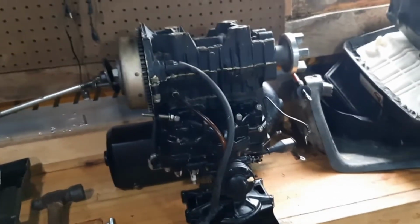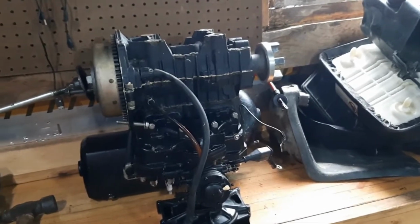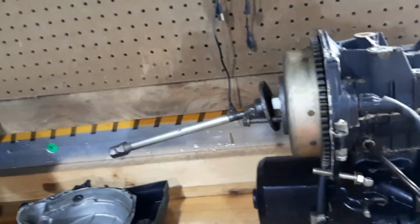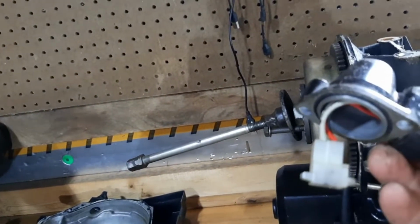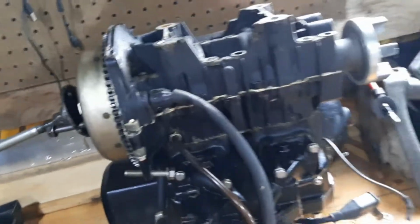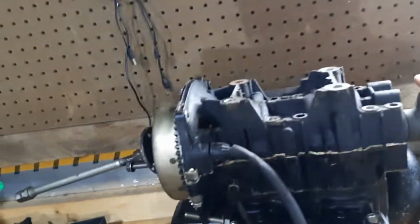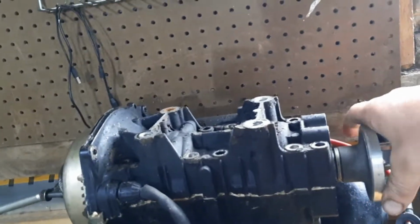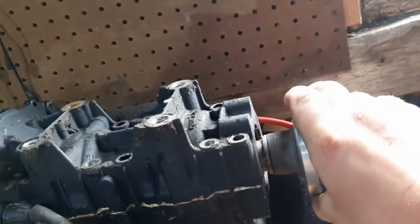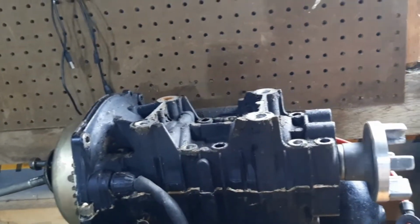It's a 550 two-stroke Kawasaki unit and it is water exhausted and watertight, like these bulkhead fittings and this massive alloy cap to make everything watertight. So they are watertight for use in salt water. So the problem we've got is we've got great compression. The engine turns over freely for the most part. But this is a 1980s stand-up ski.